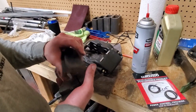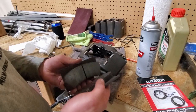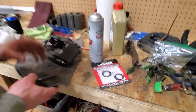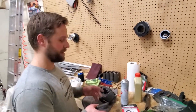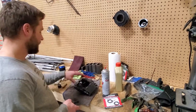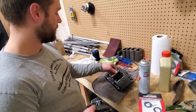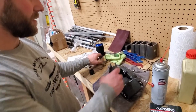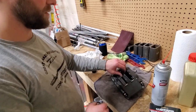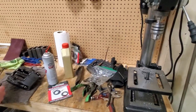So this one's done. I'm putting the brake pads back in — these are from last year, they're rear, so they don't get too much wear on them. These calipers are pretty nice. Unlike on your street car where you've got to take the whole caliper off to replace the pads, if this was still mounted on the hub you just take this bolt out and you can switch your pads out. So this one's ready to go.